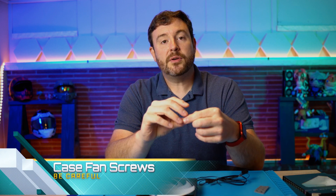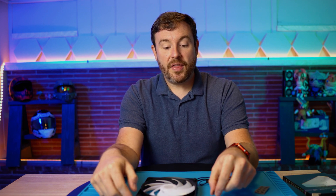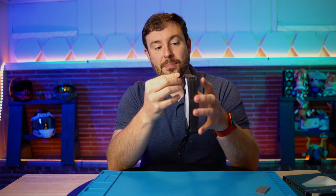I talked about this in a previous video when we were mounting the AIO solution for the CPU. These screws right here have a very aggressive bite to them. They are designed to screw into this plastic housing right here. What you're going to do is place the fan, then go on the opposite side of the case and screw this through the case into this plastic. These screws bite into the physical plastic, and if you have a good manufacturer, this should not break. I have seen some fan assemblies crack as you're screwing this in — not even over tightening, just simply the act of screwing it in causes cracks. I'm hoping that these Phanteks fans won't have that problem.